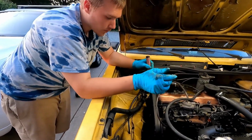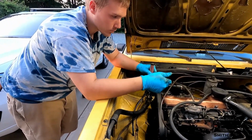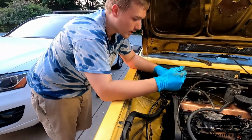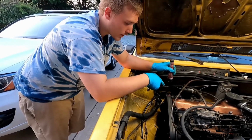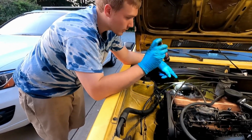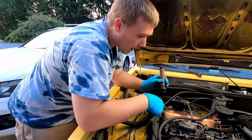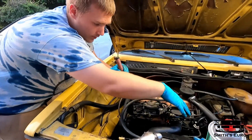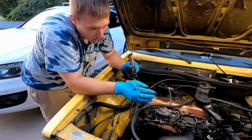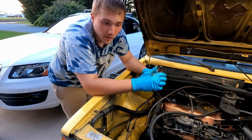Now I'm just taking off all the accessories. I'm draining the oil now, because anytime you lift the head, coolant gets in, which in this case is water. So you just gotta drain. And then it has a turbo back there, so I gotta undo the turbo drain line and then undo the turbo feed line with the belt off and all that good stuff. I can just run through here, pull all the injection pump lines off, all the coolant lines, and then pull the valve cover off, and then we're basically ready to go.